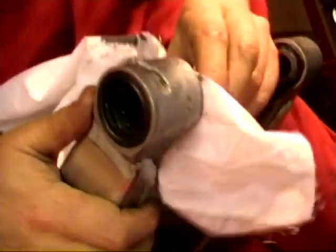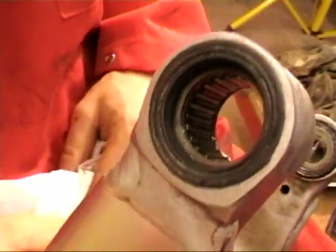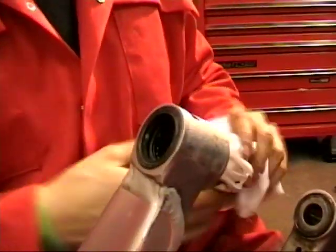So you've got one of the bushes out now of the swing arm. Yes indeed — you can see the needle roller bearings. They're ones that start... some of them just drop out when you pull the bush off. On the elephant they do that, which is wonderful — counting all those tiny little fraction-of-a-matchstick-sized bearings. You count them all out and you count them all back in again. I think those ones don't actually have a cage — they just all sit in the outside casing. You've got to put them back in. Usually there's a small gap and you're thinking, does another one go there or not? It doesn't — there's always a small gap.